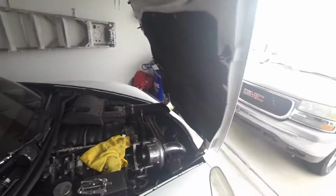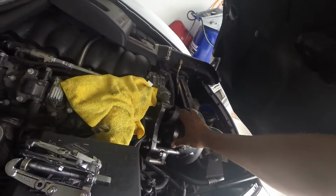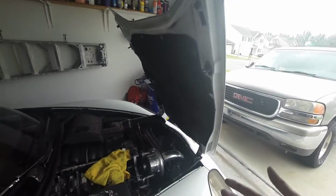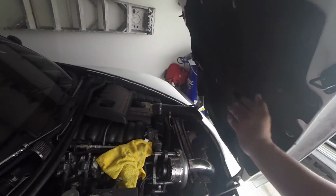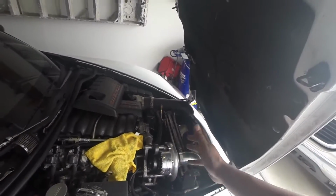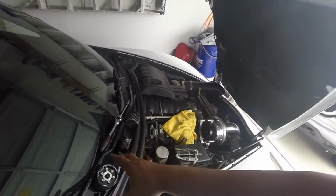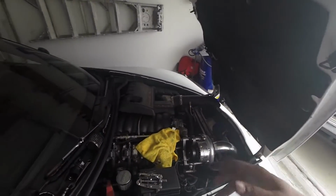This is on a Corvette, taking off the pulley, which is a 3.25 pulley. I had a 3.15 that I was tuned on, that was a carbonite pulley. It was made out of aluminum, and the keyway ended up wallowing out, and I had to put the 3.25 on to be able to drive it until I got another one, and I ended up going with the Grip-Tec. They told me that they use aircraft steel aluminum. It's a harder aluminum. It won't wallow out. It's a lot better quality.